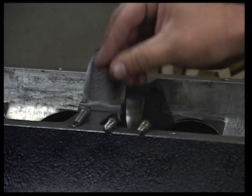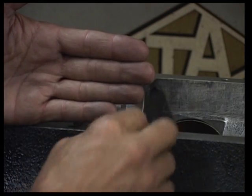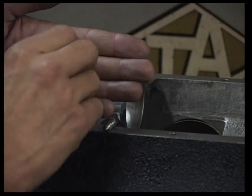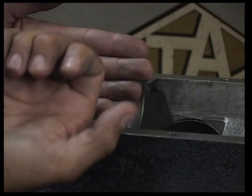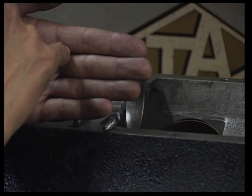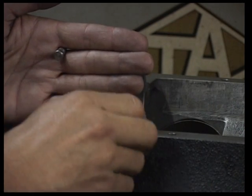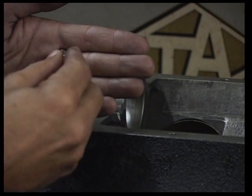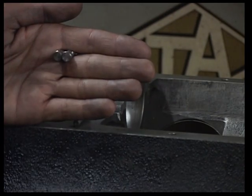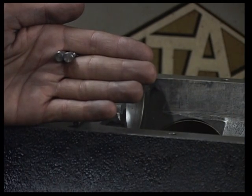Okay. So when you're putting these together, let's just say this is our crack right here, and you're going to drill a hole, tap the hole. Correct. And then screw it in and tighten it up, and the hooks are going to kind of pull it together if you're using the hook pin. It's going to break off, and then you're going to need to drill another hole, almost halfway on top of it. It will intersect it about 20%. So by the time we're done, you're going to have a few of them like that, knock all the heads off, grind them, and then you got a milling process after that.